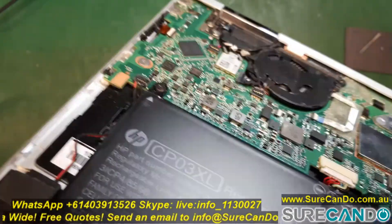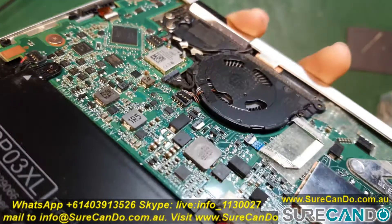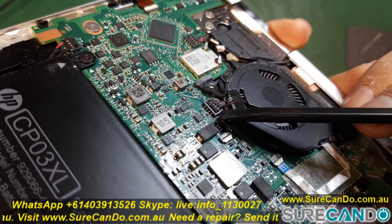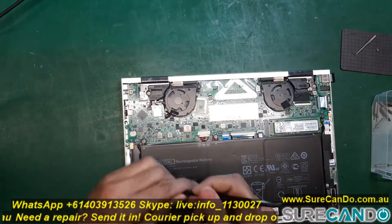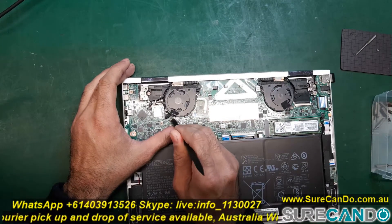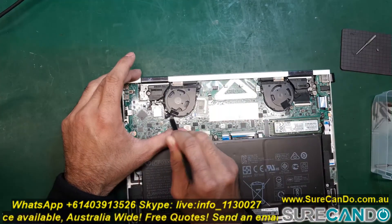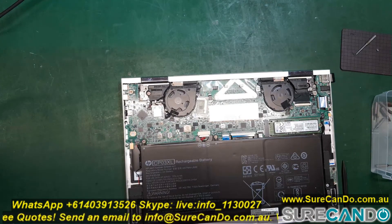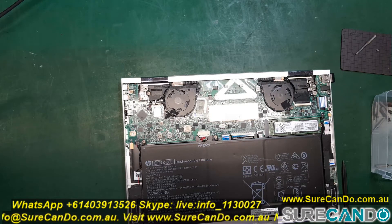It's my first time opening this since we got it back. As you can see, the connector for the fan has actually come out a little bit, which is quite unusual because we make sure they're fully secured and properly in place. The one on the left has come out, but the one on the right has not. I'm assuming the power pins are still connected yet the sensor — the data cable — is not making contact, and hence the motherboard is complaining it can't get feedback from the fan, which makes sense, but it's actually working.